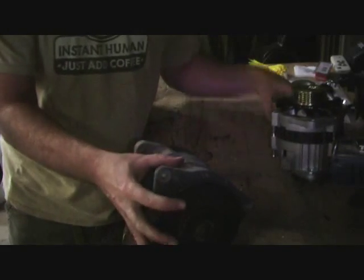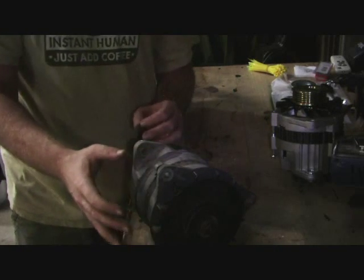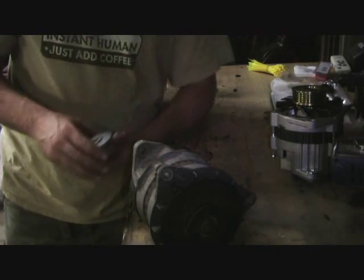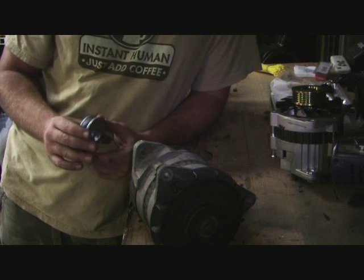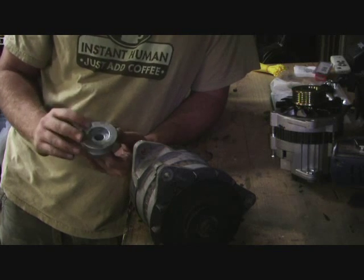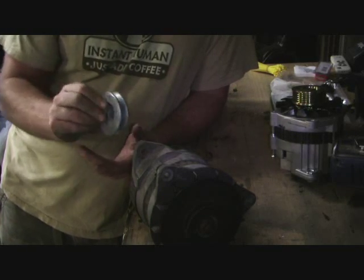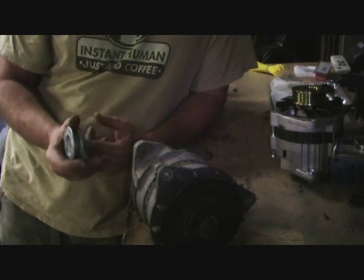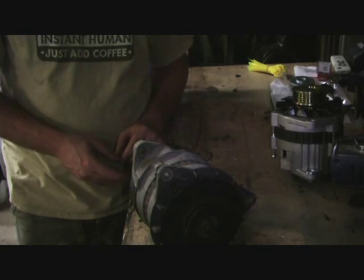In addition, the pulley on the front of the older one is a V-belt pulley, and the one on ours is a serpentine pulley, so we're going to have to replace the pulley. The diameters of the older Lucas-style alternators are smaller than the modern ones, so you can't just do a straight pulley swap. I picked mine up at Napa - they were the only auto parts place in the valley that actually had the GM unit directly in stock, and they happened to have a V-belt pulley too. Try asking at your local auto parts store, or you may need to call an alternator shop or dig through parts bins.